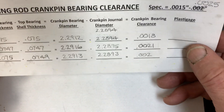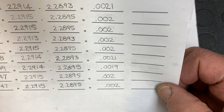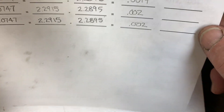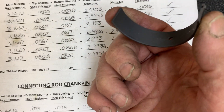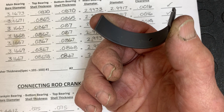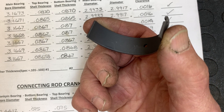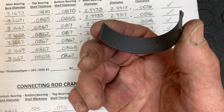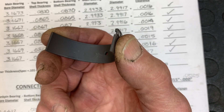Now both of these crankshafts were almost exactly the same diameter in terms of journals, so you can see that I am clustered right around two thousandths of an inch, which is where I really want to be. Now this is not the reason why you put dry film lubricant on bearings. The reason that you do that is so that in the case of momentary oil starvation, or when you've got a dry start-up, which a lot of these cars are subject to, the dry film lubricant is sort of a safety cushion to prevent damaging the bearing itself.